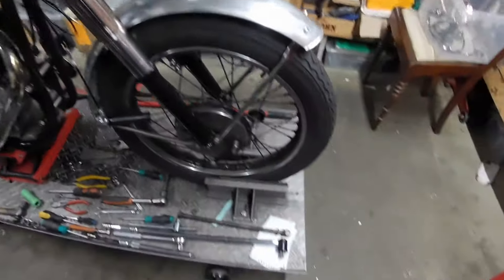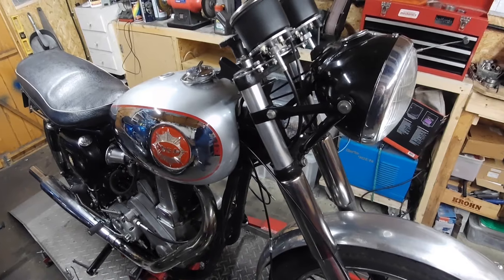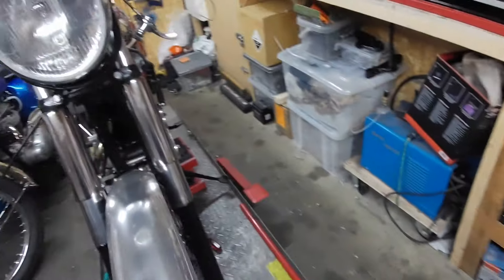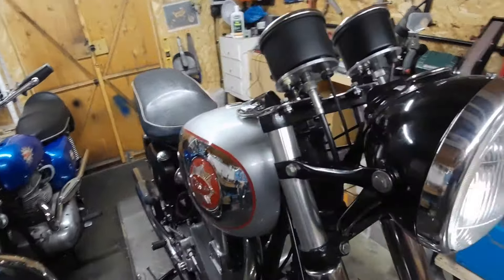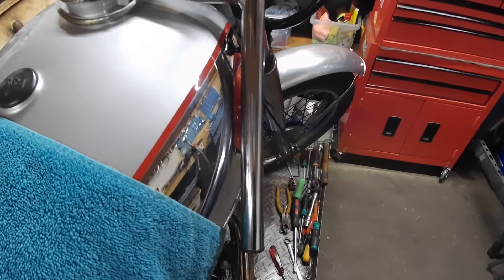I'll put the bars on and roll off the ramp, or just remove the front wheel clamp so I can twist the bars and make sure nothing contacts. Then I'll reconnect everything. Now the new bars are on and I've angled them up a little further than I would have liked, but even then on full lock this side it's just not quite touching the tank badge.